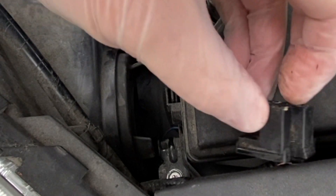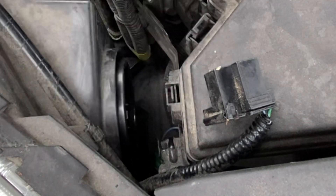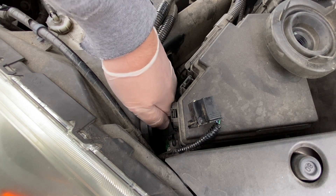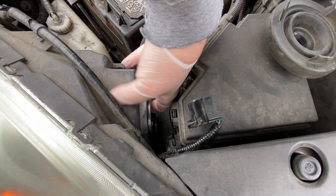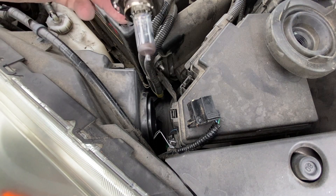We're going to go ahead and put it on the new light bulb terminals. We'll get that out of our way here. There's this little rubber boot right here that pops off — you can just remove the whole thing and set that aside. And then right down on the inside there is this retainer clip. That retainer clip just holds the light in there. Pop that out and the bulb pops right off.